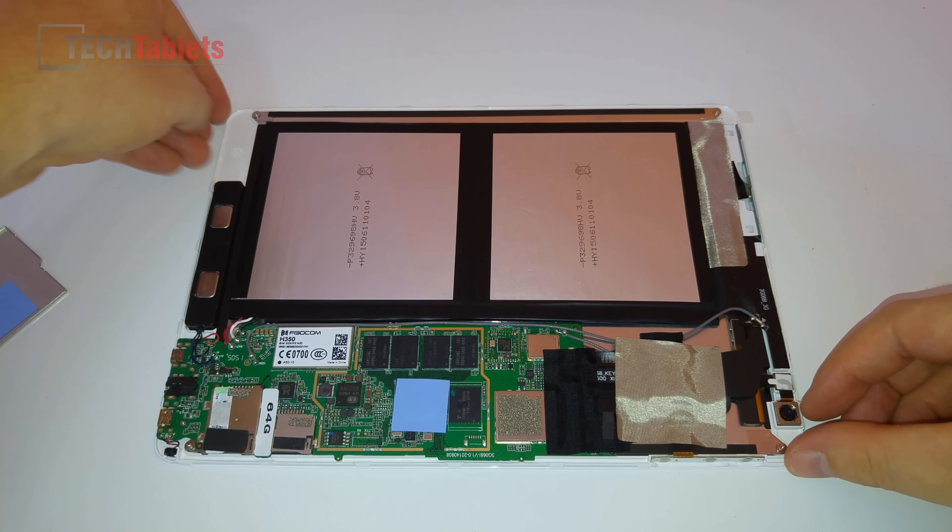I don't really think it's necessary to do this, but it will definitely help lower the temperatures and it might be able to turbo for a little bit longer. I went a little bit overboard with the thermal adhesive paste on the RAM chips — a little bit squeezed out on the side, but that's not too much of a problem. I put two copper plates there between the RAM chips, and then the larger one — this is 20mm by 20mm here on the actual CPU die.